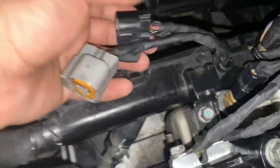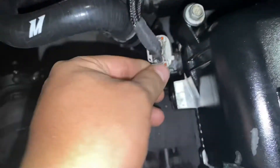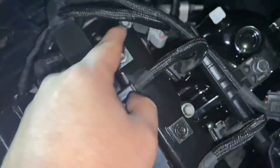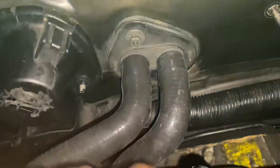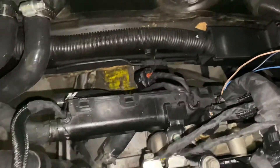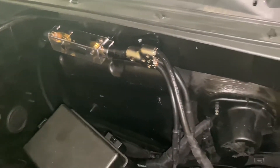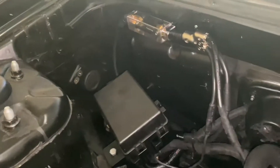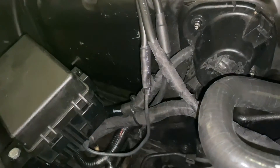Looking over the back part — pretty much good. These two connectors are the only ones left hanging for now. This is your exhaust cam sensor, this is your intake cam sensor, and then you have your coolant hose going right here — the top goes to the left one, the bottom goes to the right side. I'm gonna clamp those down. Everything in the back is done: coolant lines plugged in, and all my power cables are connected. My battery is relocated to the trunk so I did my own battery relocation.